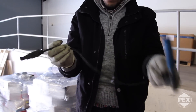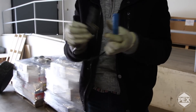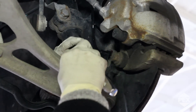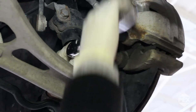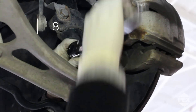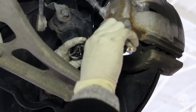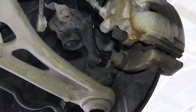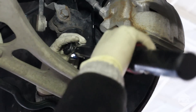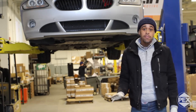As you look at the genuine OE sensor you can see the installation is identical to this PEX piece we just installed — it's a wonderful part. This is a five or ten minute installation at worst, something you should definitely be doing yourselves. The torque spec for this bolt is 8 Newton-meters — snug is fine, it's not something you want to over-tighten, so I'll do snug and then follow it up with 8 Newton-meters.